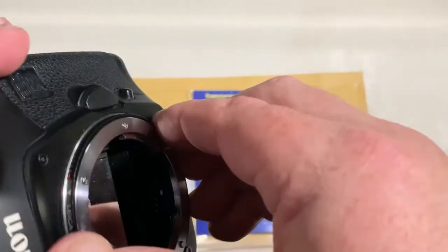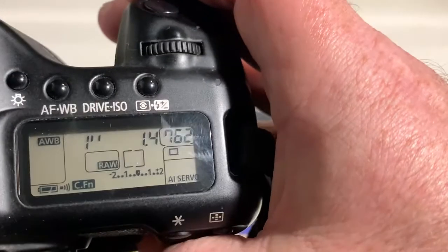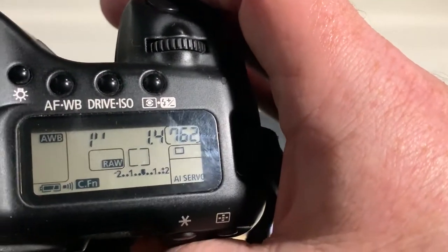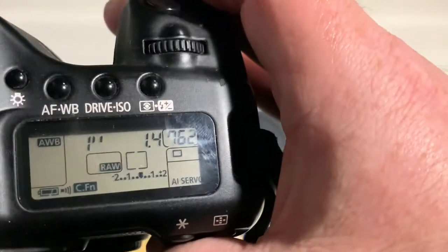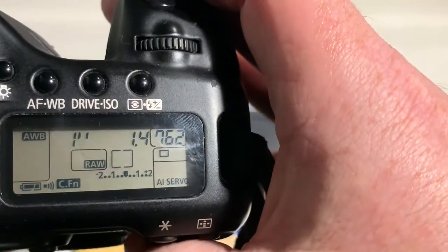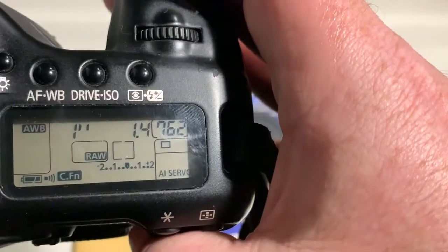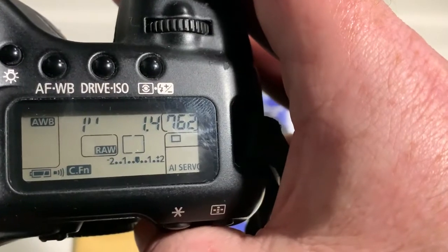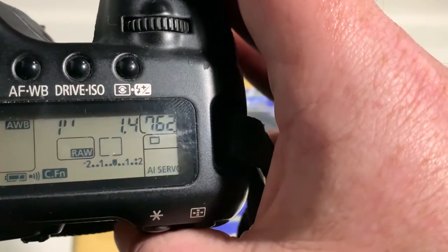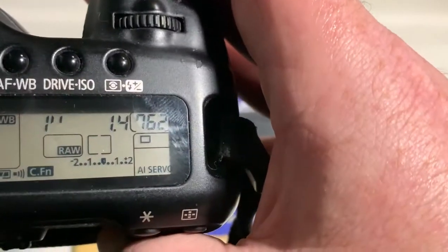I checked the adapter in my camera. I pre-programmed the chip on the adapter by default. You can always reprogram the chip using our programming instruction and my video instruction about basics of programming the chip. The pre-programmed chip focal length is 50mm, aperture 1.4, delay time to enter programmer mode is 1 second, and Focus Trap mode is on.